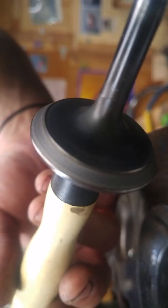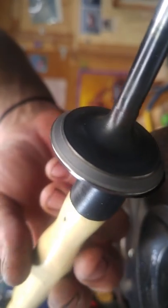That's a little too wide on the center margin, so we're gonna keep grinding it down. You don't want to have any lip or anything in there - you want to get it down to whatever the book says. On this one it's one thirty-seconds of an inch. Add just a little bit more of that paste - I have it piled up here so I can take a little dab without having to drop the tube every time. Come down just like that, and you're just gonna keep doing that until you achieve what you're looking for.